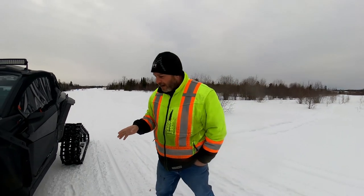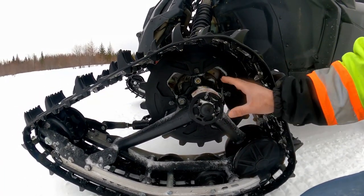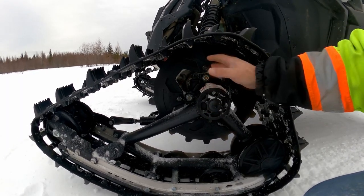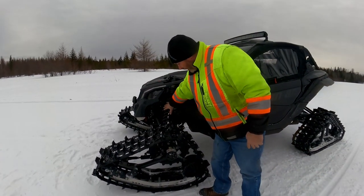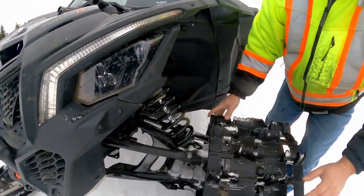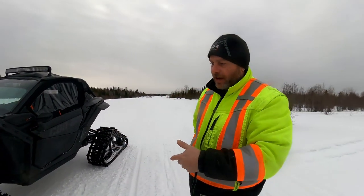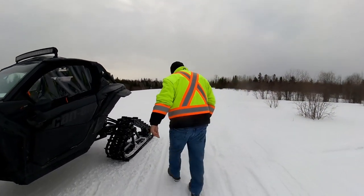In the first year, the only thing that happened was one of these covers popped out. They told me these aren't serviceable, and the bearing blew inside, popped this out, and made the track go sideways where the sprocket went like this. I'm glad I had a ratchet strap — I twisted the track around the A-arms and the spring, put the ratchet strap on, and used the slides as a ski. Put it in two-wheel drive and just drove it away. If the track comes off, use your front slides to get out.